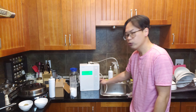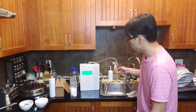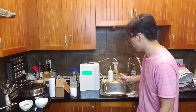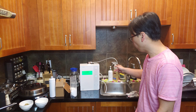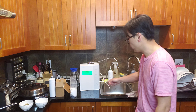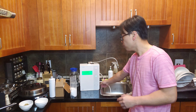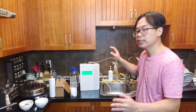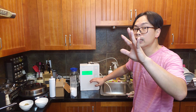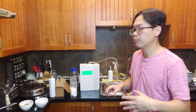Make sure the water flow is at full — basically maximum. The machine turns on and off, rinsing through cycles by itself. If water is flowing out at the bottom, top, or very slowly, turn the water flow up — don't turn it down. You want around 1.5 to 2 liters per minute minimum.